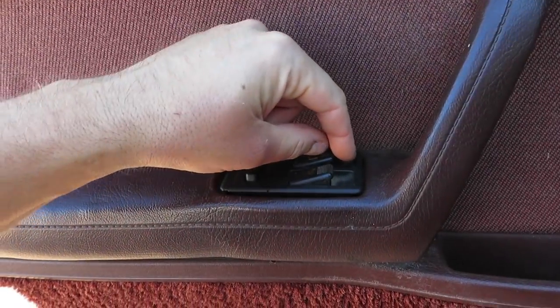I'm not exactly sure, but the way you can tell that is on these older cars, every time you go up or down, the switch switches 12 volts instead of ground. And what that does is it leaves a little bit of carbon tracking every time. Car manufacturers figured that out early after it started doing it, because stuff started failing, and when you switch grounds, it doesn't do that. So the other switch has a lot of carbon tracking, or the other electronic base from one of the switches that I got. That's most likely the reason it wasn't going up and down on either of the windows. And I could clean that up with a little bit of emery cloth. It also deforms the contact, so I'd have to use a file on it to clean it up a little bit better.